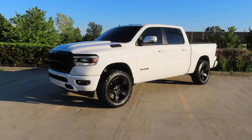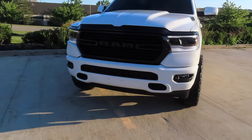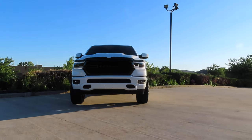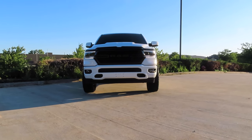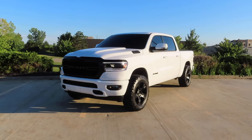So now what we have to do is take it to my local Bell Tire. They're going to do an alignment because my camber is off in the front. As you can see, it might not be able to tell very much in the camera. But if I get down here, my camber is basically too much positive camber. I'm not sure positive or negative, but basically I need to get an alignment so that my tires wear correctly. But other than that, we're pretty much set guys.